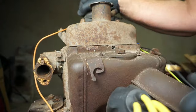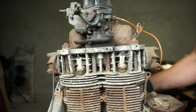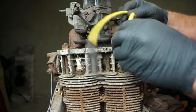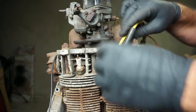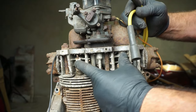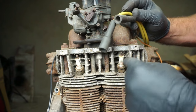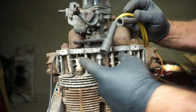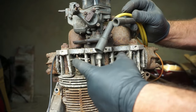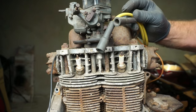Okay, let's turn the engine to the other side and go to the spark plugs. These wires, one is going there, the longer one, and this one is going there. But before we put it on, we're going to test if we got a spark. I'm going to take off the spark plugs, connect it, and spin the engine, and we see if we got a good spark. If there's something wrong with the spark plugs, we're gonna replace them with new ones. Okay,